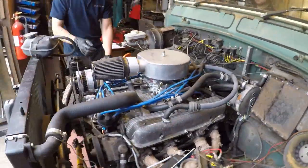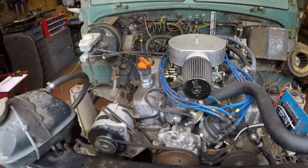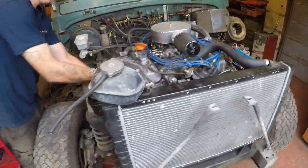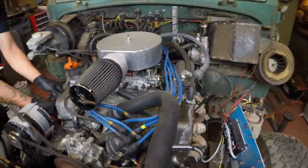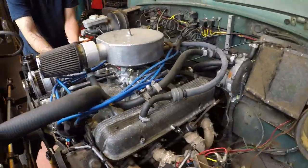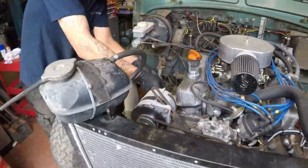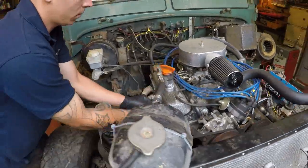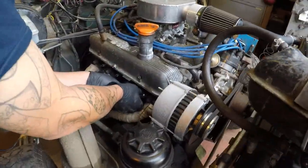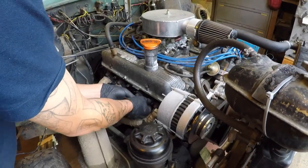Easy test to do, and you're probably doing it to check for head gasket failure or worn rings. I would expect about 150 psi per cylinder — that's a lovely good compression for one of these engines. Obviously different engines — diesel versus petrol — have different compressions; diesel engines are much higher compression.